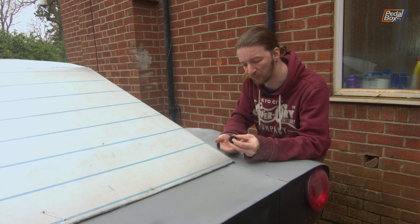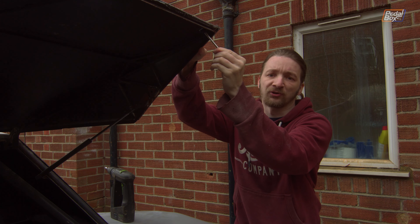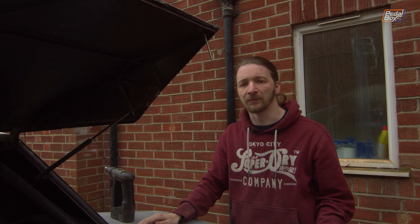The first step is transferring this opening onto the engine bay cover so we know where to put our hole. I've put one mark where the tailgate comes back to on that line, and I'm going to put another mark where our rain channel comes out to, then close the cover and transfer those lines back onto the engine bay cover. Now we know where our rain gutter runs and where our rear panel comes up to, so anywhere in this whole section up here is all clear — we can basically put our hole pretty much there and we'll be fine.